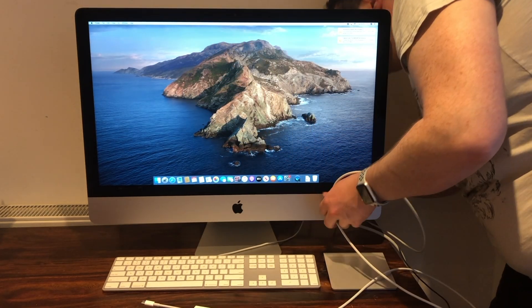This device will make a good proof of concept as it needs a Thunderbolt port to function. So how am I going to do this? Then I had a thought — a lot of docks use a cable to connect themselves to the computer, so a simple USB-C cable. That way I could plug this adapter directly into the dock, where the adapter handles the Thunderbolt signal and the dock supplies the power.